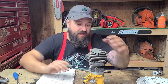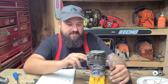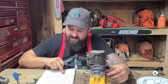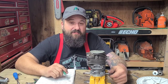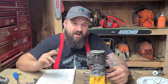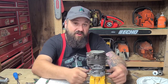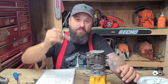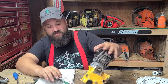If the exhaust is at 104 and the transfers are at 114, that separation is my blowdown — that's 10 degrees. We've raised the exhaust five degrees, so I now have 15 degrees of blowdown. That's still short but it's better than 10. The other thing I did: this cylinder had a small chip at the bottom of the intake — I wanted to remove that, and when I blended it out I got four degrees of timing. Stock the intake was 122 degrees of duration, it's now at 130.